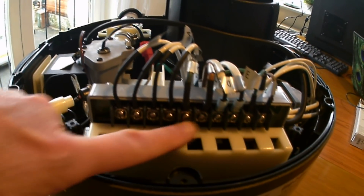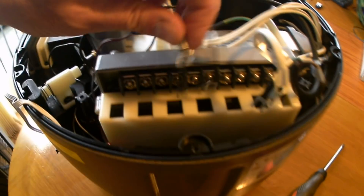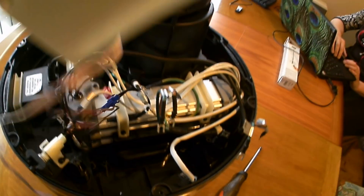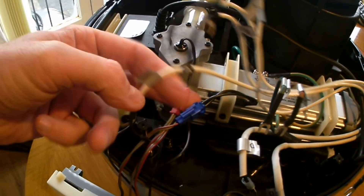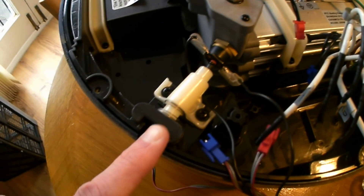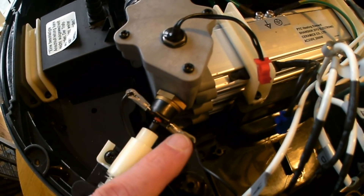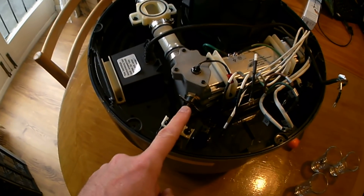I'm going to undo these screws along here and then take out this control unit. You can see these are spade connectors — you just need to undo the screws just a little bit. On my unit, this wasn't screwed in at all. Remember the red and the blue connectors — just disconnect them. The blue, incidentally, is a thermal cutout switch because that unit is the heater. This is the reset switch for the temperature. It goes through just a little magnetic connection to this little switch here. We also need to take these two spade connectors off to liberate this. That is now liberated — I'll call that a thermal reset switch.